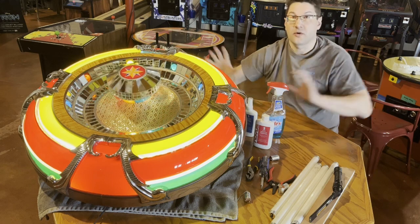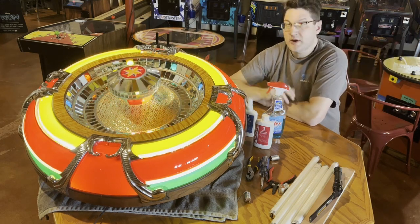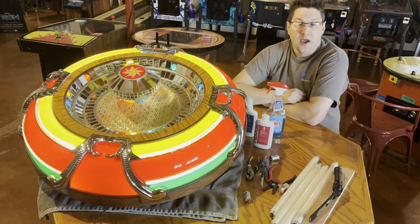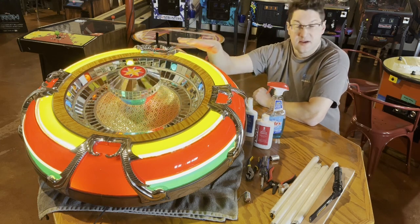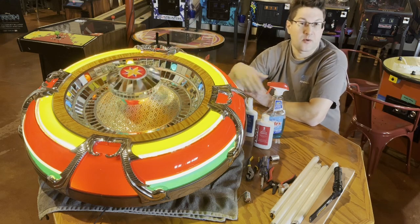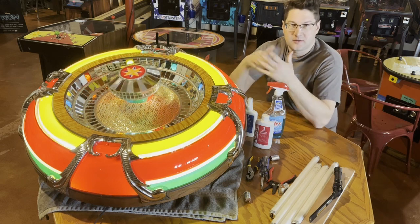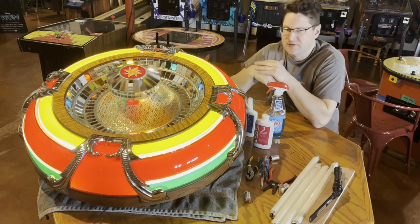That's really what they were marketed for — mount two or three on the ceiling of your establishment, pair them with the 1015, and they work great. This has an eight ohm speaker in it, and the 4008 actually had a field coil speaker that required high voltage to even let that speaker work, so it was three wires you had to run to it.